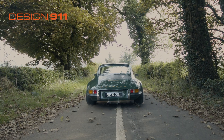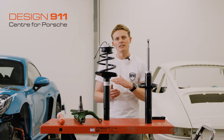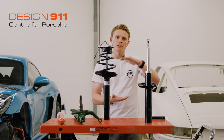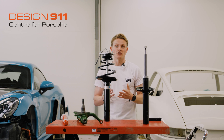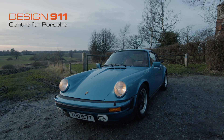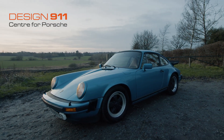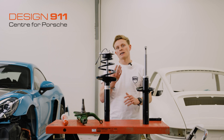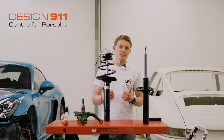Another sign is a car squatting excessively on acceleration — when you accelerate, you load up the suspension and the damper stops the car from squatting. A good check you can do regularly to see if your shocks are in good condition is to go around your car and on each corner just push down on the wing to see how the car reacts. If you push down and the car springs back up controllably and then comes to rest, your shocks are in great condition.